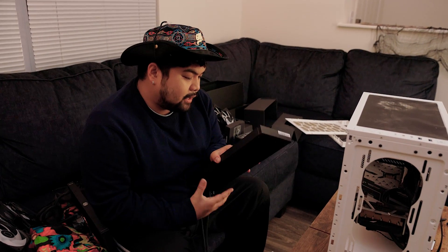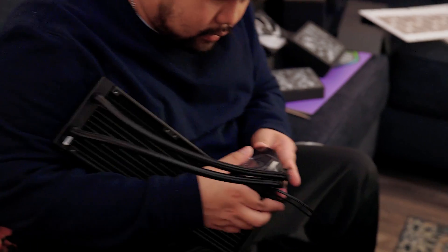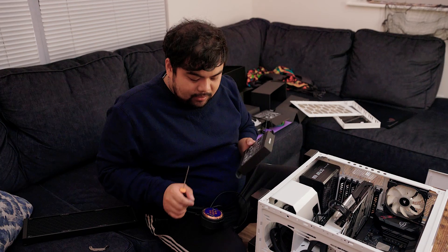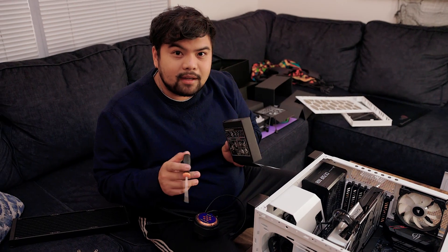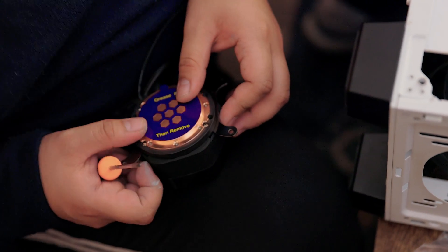For the AMD attachment, we have to insert these two little metal tabs on the Atmos itself before we mount it to the motherboard. One thing I didn't like about this was they have AMD sockets and Intel sockets, but they put the screws for the sockets in the accessory box — I thought I was going crazy for a little bit. Just keep them all on one side. But I think what they were doing was making all the screws interchangeable, so you could use the screws for either the Intel or the AMD socket. Just remember that when you're installing.